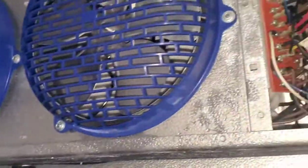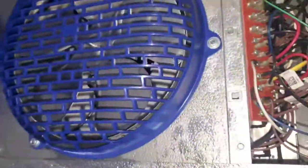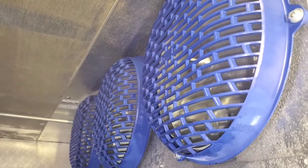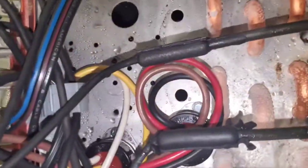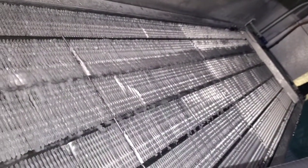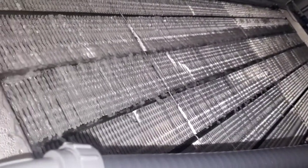And that's the reason why the X-Wire set it to a 4-hour defrost. So here's what it took: I had to move that defrost thermostat closer to the coil because it just was never going to get cold enough over there. Look what it's done — and with luck that'll all melt.